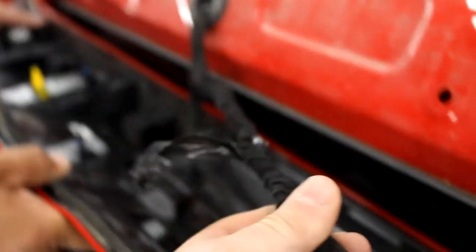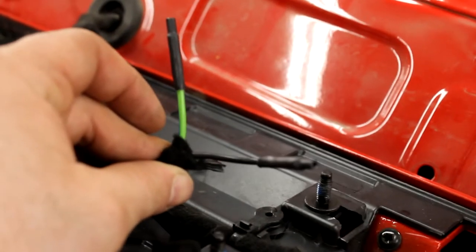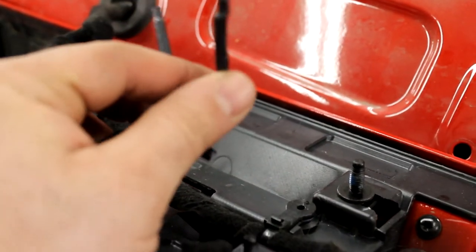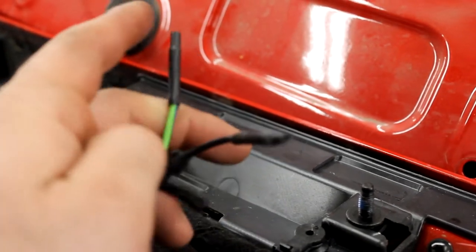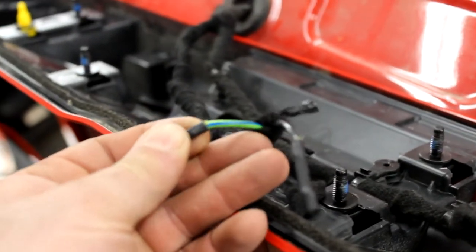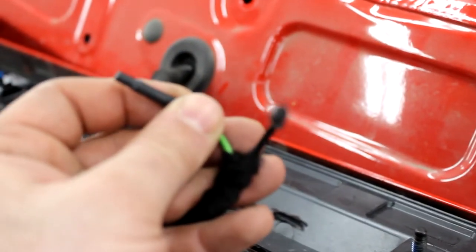So we will undo this. I'm guessing that this wire right here is our auxiliary 5 because we have not touched anything with the brake. I simply unwrapped it with my camera in one hand, and lo and behold I found a ground that ended and there is our auxiliary 5 with the green-blue stripe. So with any luck we're going to take that light, bring the wire down through here, connect it right here, and done.